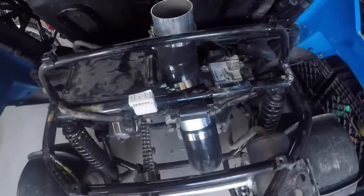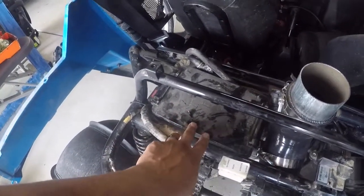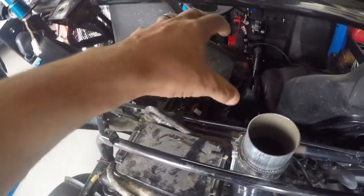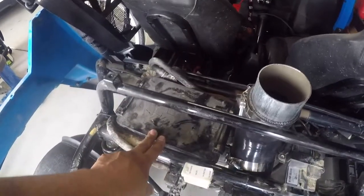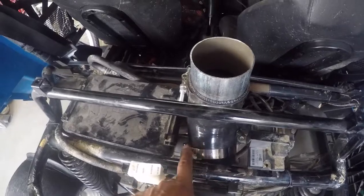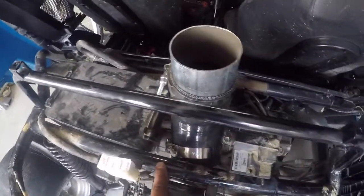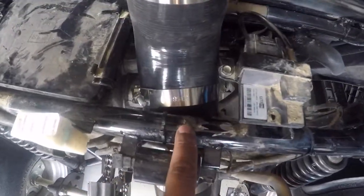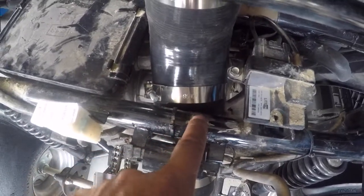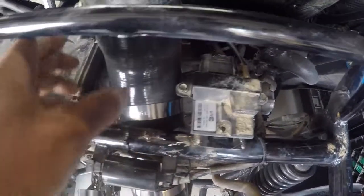Alright guys, I've got the tubing all run. A lot of people remove the air box when they snorkel it up top, but I wanted to keep the factory air box and run this right along the side. One thing I ran into was limited space — that pipe is about a four-inch OD. I ended up shifting the mount over two inches to give me some space, and I welded in a spot where I cut slightly into the tubing.